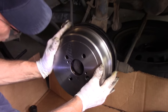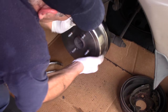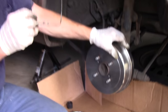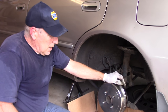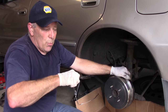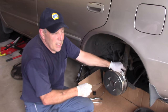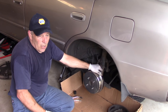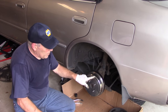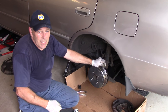Now we take our drum, put the drum on — you can see it just spins really freely — and we're going to make an adjustment to get it a little bit tighter. That clicking is a normal sound; you just turn it just like that. Put the drum over the top, and that's how the drag should be — you should have enough drag so that you spin it one revolution and it stops. This job is done. We're going to put the wheels back on and go to the other side. After you finish all the brakes, you want to pump the brake pedal up so you have a nice firm pedal. Your parking brake and regular brakes will be adjusted. Put the wheel on, road test, and you'll be in good shape. If you get a little bit of smoking out of here, don't worry — it's perfectly normal from the grease burning off. As always, thanks for watching and I'll see you on the next one.